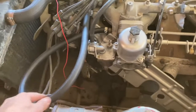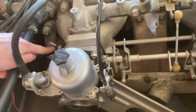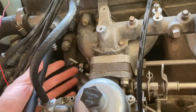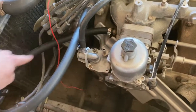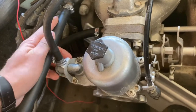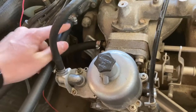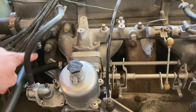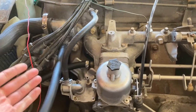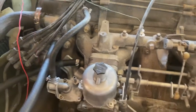I've got the carburetor hooked up to the thermostat housing using a long piece of tubing. I first tried to go straight across with a shorter piece but the angle was too acute - the hose was kinking. So I used a long piece that takes a wide sweeping turn with no kinks. I'll eventually fabricate some tubing - rubber on each end with a metal piece braced together. On the 1972s they probably had a special molded hose for this, which I don't have, but I may be able to find one.